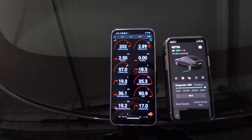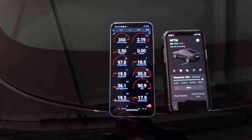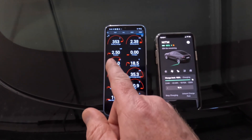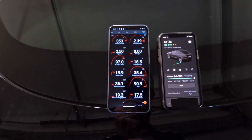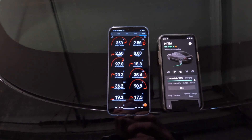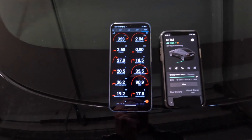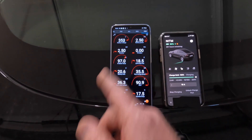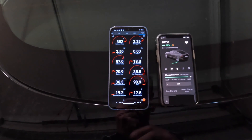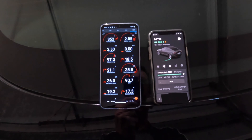That power is flowing through the outer part of the motor called the stator, where all the current flows through in this style permanent magnet motor. What that's doing is powering up the windings of the outer part of the motor at a state that doesn't produce drive, but it's enough to heat those stator windings up — it powers them up out of phase so the engine just can't drive. This is the same sort of thing that happens when you're preconditioning for fast charging and you pull up at a set of lights, even when you're not plugged in — the rear motor will be powered up and helping to heat that battery.